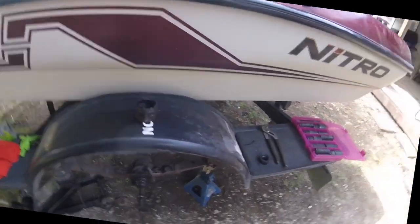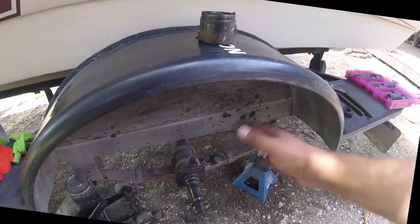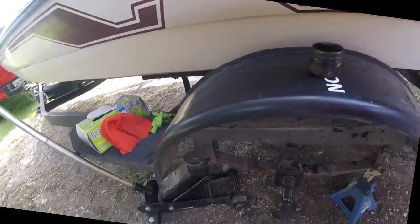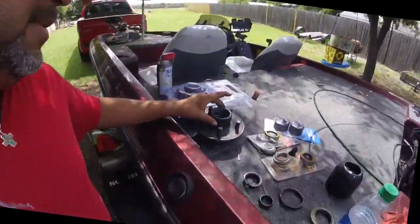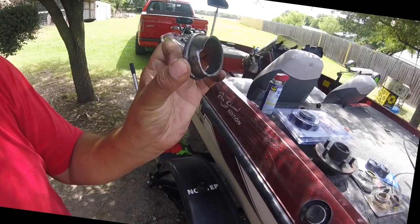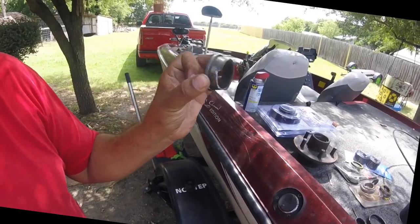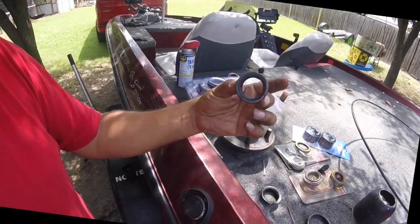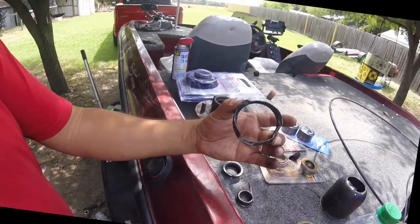Already halfway through the steps — pretty easy. You got your cotter pin, you take out your nut and washer, and my whole wheel just fell off after I did that. There are a lot of videos out there showing you step by step how to do it. My scenario is a little different — they just replaced bearings, but mine seized up in the hub. I banged on those suckers, tried to get them out, beat it with a hammer. It started chipping and that stuff is sharp — it will cut you. The outer bearing fell out real easy, and my grease seal goes right there at the very back.